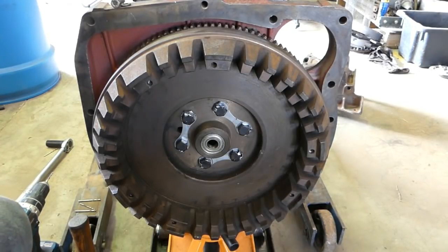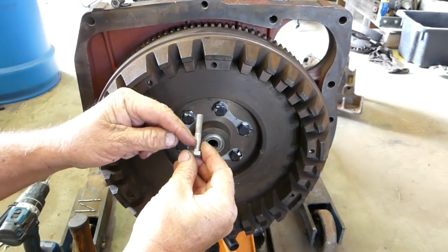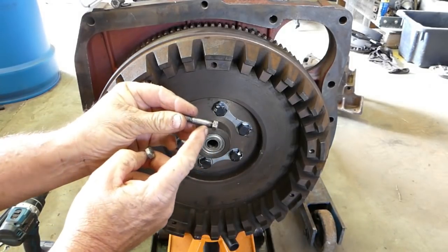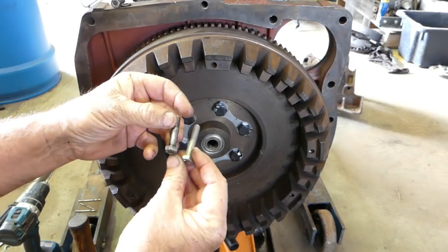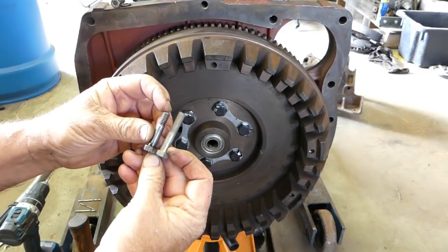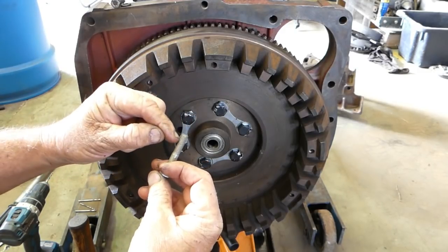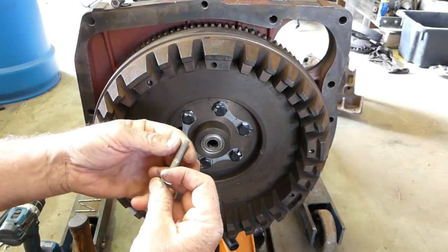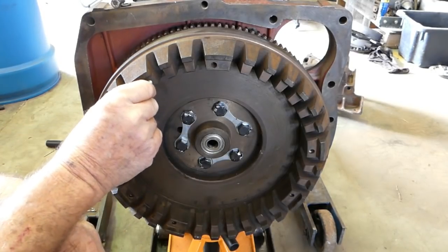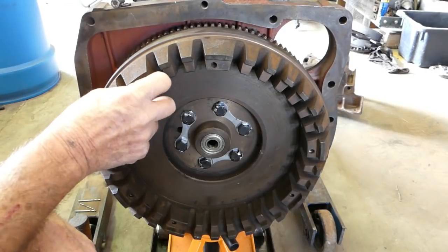So with our new bolts, I've gone a little bit longer so we can try and replicate this little bit of flat there. I can't do it exactly, but look, it's pretty close. So now on all six bolts, I'll dock the end off them, about four threads' worth, and we should have a nice new set of bolts, and yeah, I'll feel a lot safer about it anyway.